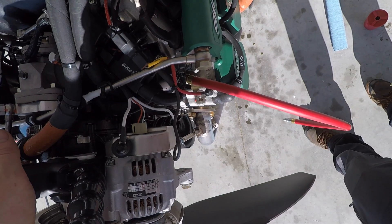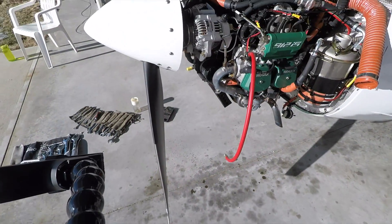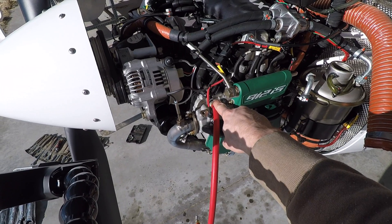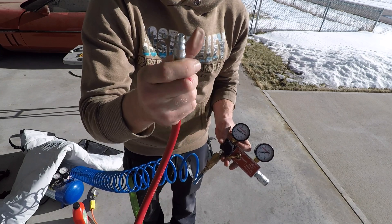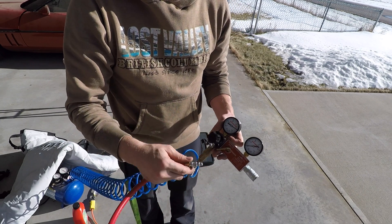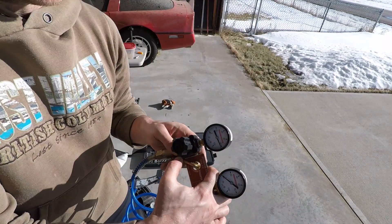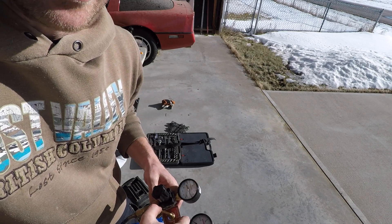We're going to test the pressure on the cylinder. I'm at top dead center for this cylinder. Basically, just put your finger over the hole until air pressure builds up and pushes your finger out. Connect it to the cylinder, hold the propeller, and wiggle it back and forth to see how much PSI you can get. Make sure you're not standing in the way of the propeller — open this little lever and that's when it'll start to kick the propeller over.